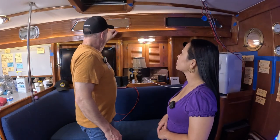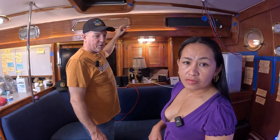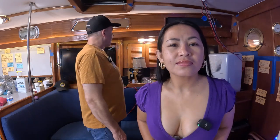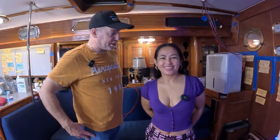So yeah, that broken screw was on the outside where we were trying to install the retainer ring. And I got a little too greedy. The screw was epoxied in when we bonded in the window retainer frames. Oh man, and it broke. So anyways, we have to drill that one out. So hopefully we can get that out. I've drilled them out before. I've had pretty good success drilling them out.